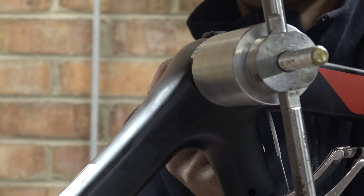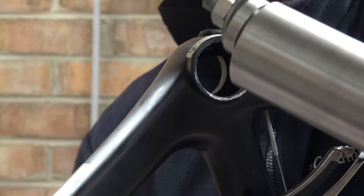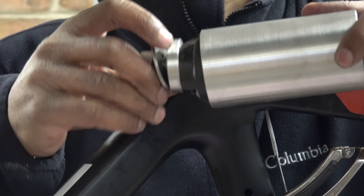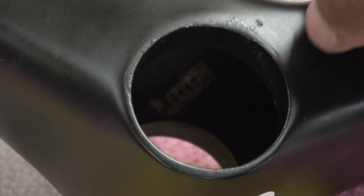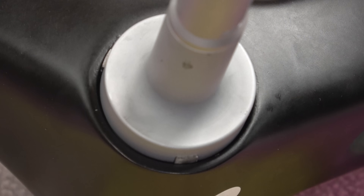It's much better to do this than to hammer it out — it puts the frame under much less stress and it should just pop out like that. That black thing there is the bottom bracket cup on the non-drive side, and you can clearly see a load of irregularities around it — I'm not sure if that's paint or something else. It's also not a uniform thickness all the way around. When I put the micrometer in it is reading 40.86mm — so it's well undersized.